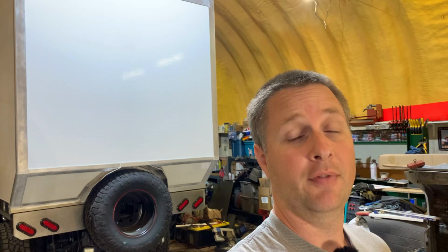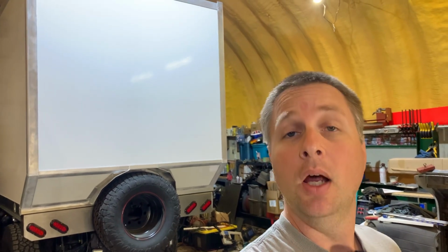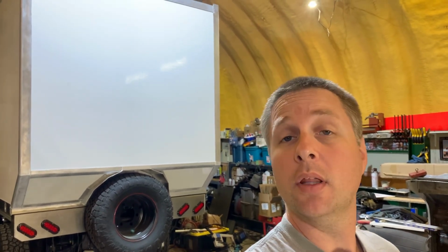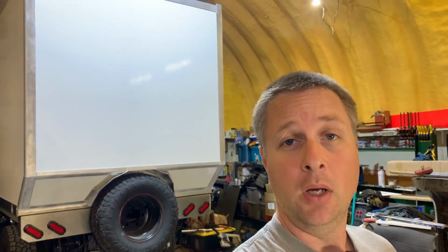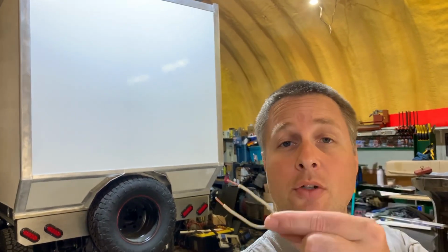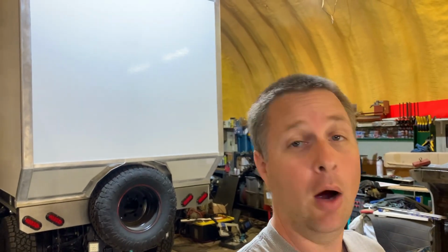So here's what I was thinking. If those 3 wires in fact are supposed to all have power and they all feed the ECU and one of them does not have power, that would be a good reason for the truck not to start. The easy way to prove this would be to insert a jumper wire in so that all 3 wires get power. However, unfortunately, the only thing I've proven to this point is that I am a giant dumbass.